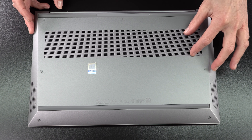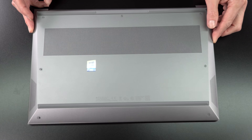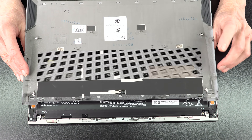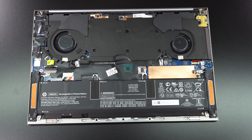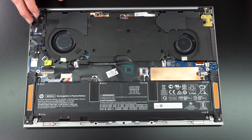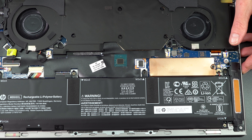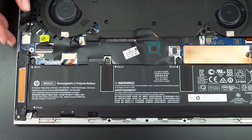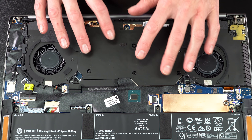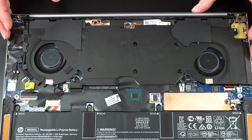Here's the bottom cover with large intake air ventilation exhausting out the sides. To take it off, there are seven Torx T5 screws — and then it comes right off. You might have to pry just a little bit with a guitar pick, but nothing too hard, and they're captive screws so you won't lose them. Looking at the internals: for a mobile workstation, it's a little disappointing that the RAM is soldered on board. We have one M.2 SSD under this attractive copper heat sink, which is also useful for spreading heat. The 83 watt-hour battery is here, along with pretty large drivers with an interesting orange color — no wonder they sound pretty good. And here are the fans and the vapor chamber cooler, which takes up a heck of a lot of space, reducing the room for things like RAM slots.